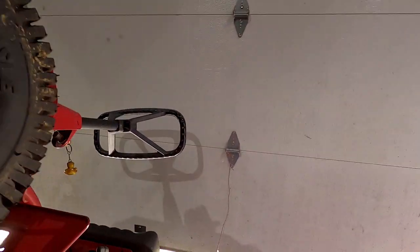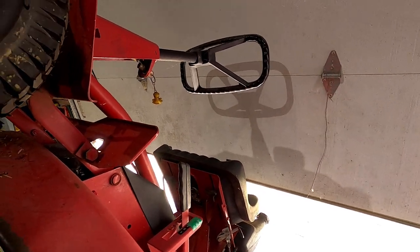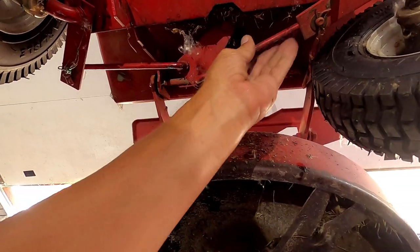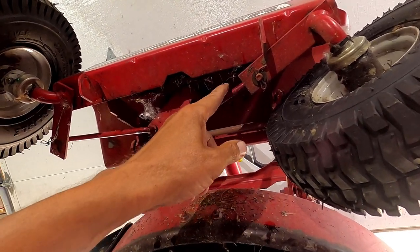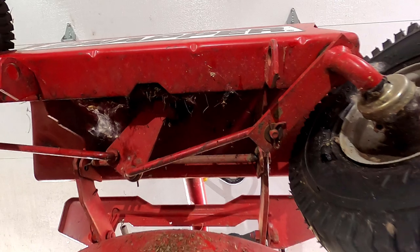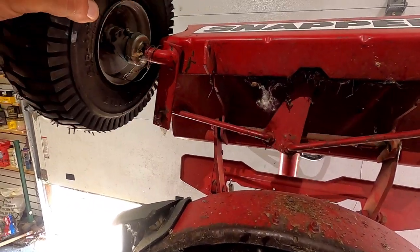But, well, you would be using the steering wheel. But when you're going downhill with a lot of weight on the front tires, it's really hard to get it out of that locked position. I mean, I could probably put a limiter on it. Yeah, this rod right here is almost parallel, so... I mean, if you could put a limiter right here, maybe that would do it, so that it can't get into that locked position. It does do it on the other side, but it's easy to come out on the other side.